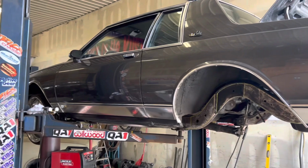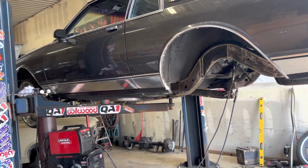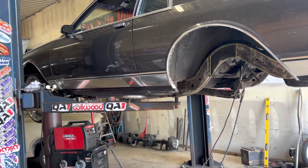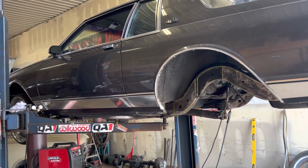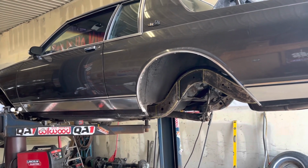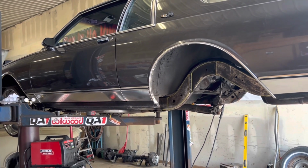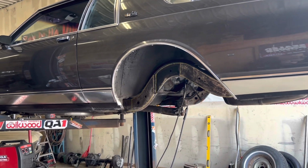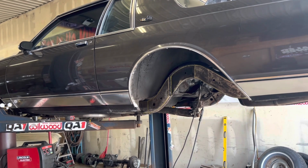everybody get their parts, and I obviously let you know the correct parts to get, so that way you guys aren't wasting your money. These level 1, level 2, level 3 QA1 kits, you can't use on big wheel cars. If you got a basic lip, then you can use the sway bar that comes with it. If you got a small wheel, you can leave the non-adjustable lower control arms in it. There's just stuff with the kits. If you want it to be bolt-in, yeah, whatever.